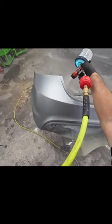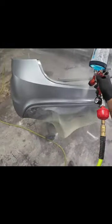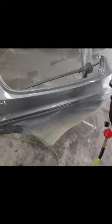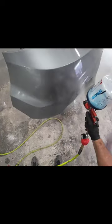As I'm laying down this clear coat, I'm evaluating how the clear is going on the panel. If I need to speed up or slow down, I will do that. So if I have too much material coming out of the gun, I don't have to adjust my settings — all I have to do is speed up a little bit. I spray about four to five inches away; that's just how I like to spray. I'm overlapping 75 to 80 percent.